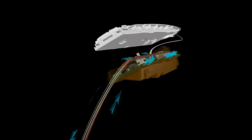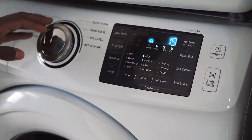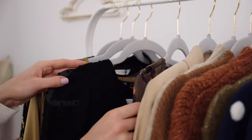To start with, the user fills the detergent and fabric softener tray. There are usually three sections: the section marked number one is for the pre-wash, number two is for the main wash — this is the main one we use — and the last one is for the fabric softener. Then the user selects the desired type of wash, such as delicates, synthetics, quick wash, and heavy loads. Each of these has a corresponding temperature, wash time, and spin speed. The variation between wash types is because of the many different types of fibres that make up our clothing today, and they all have optimal washing conditions to balance the prevention of damage with rigorous washing.